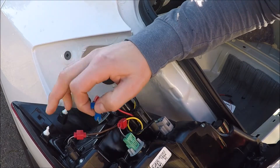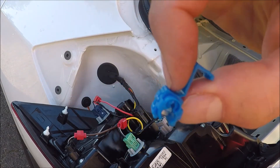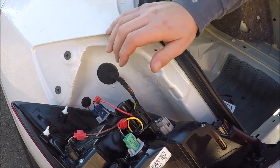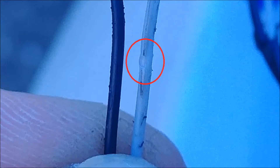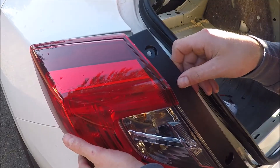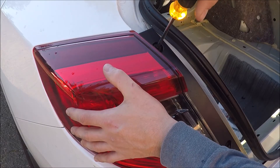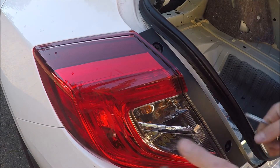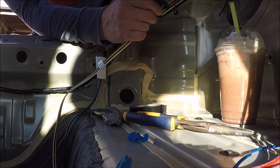I swapped from the blue connectors to the red ones because — if you can see — that slot was too big for those wires, it didn't even cut in, it just dimpled them. I've got a picture on my phone so you can really see what I'm talking about — it would not have made a connection. Line the two tabs back up right there and pop them in. I recommend always starting everything by hand — it's easy to strip something if you just go straight at it with the impact.